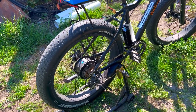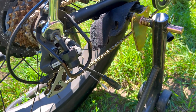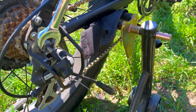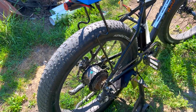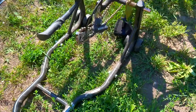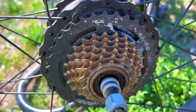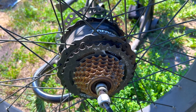Here we have the bike ready to remove the rear tire — it's going to be an 18 millimeter. Get it loose as far as you can; I already did this side. I took out the protector and was able to pull the wheel out — very quick process, took just about five minutes. Now we'll take the wheel inside and disassemble it: remove all those screws around the hub and swap out those nylon gears.